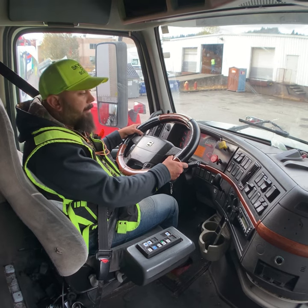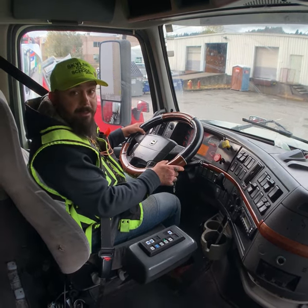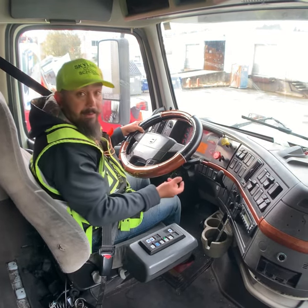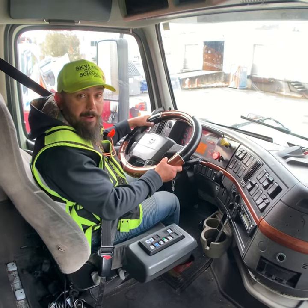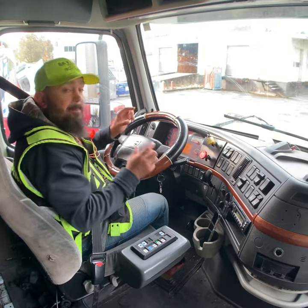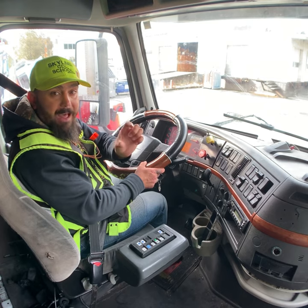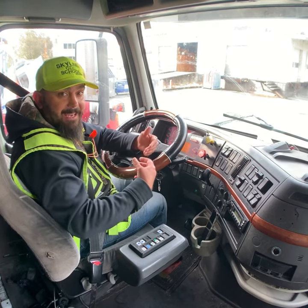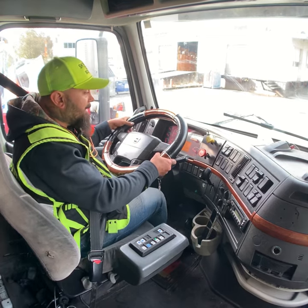Last one, test name: tractor and trailer protection valve test. Explain: tractor and trailer protection valve should pop out at approximately 40 psi. Minimum is 25 psi, you have to know that. I pump my service brake again.